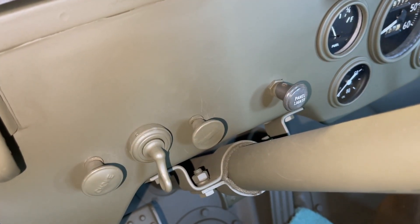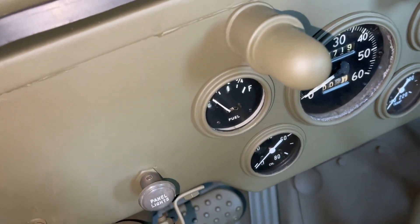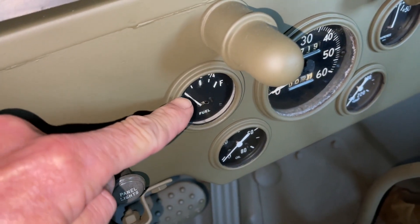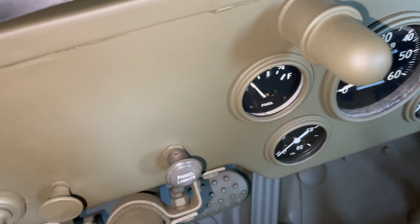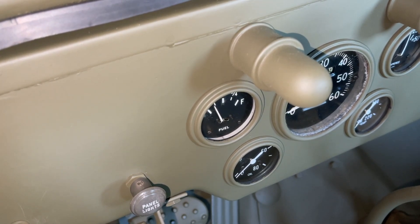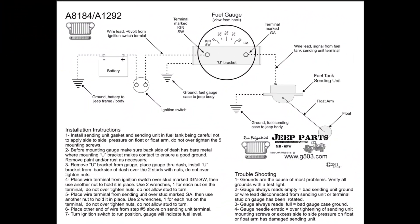One last little secret: the bond strap that goes from the dash on the firewall to the fuel line is actually how the gas tank gets its ground, and in turn your fuel sending unit gets its ground. Keep that in mind — there will be a full bond strap video coming in the near future. For now we're going to test what I did here. All I have to do is toggle my ignition switch and I should get a reading on my gauge. I know I've got about a quarter tank of gas in the tank, so I'm just going to throw that switch — and there we go, it works! I hope you enjoyed the video and it helped you with your Jeep fuel gauge installation. I also included a flow chart that Scott Watson of Ron Fitzpatrick Jeep Parts put together to help you diagnose any problems with your fuel gauge sending unit and system. You can pause the video, take a screenshot, and print it out for your own personal use. Thank you for watching.